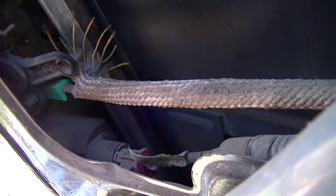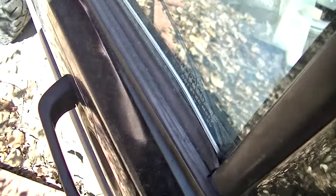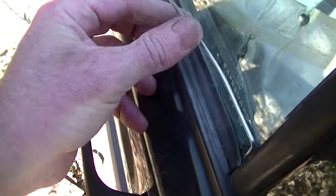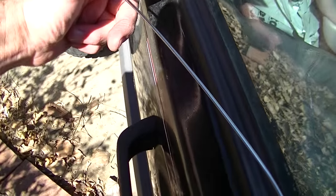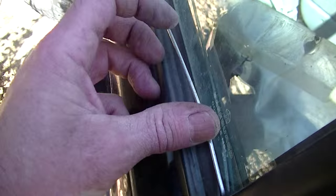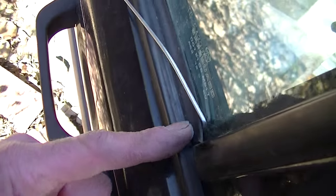What I'm going to do is take that hanger and put it between the weather stripping and the glass and try to snag that little plastic piece. On this one, because I've tried it before, I have to go in right here — that's the only spot it'll go through. The rest of the window across here has a metal framework that won't allow anything to pass. There's one spot right here, and right straight above there's another spot but that's too far away to grab it.